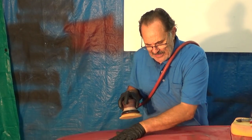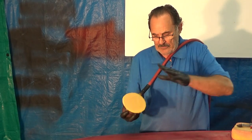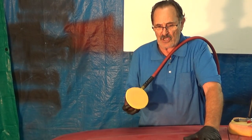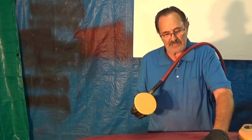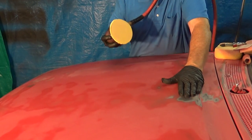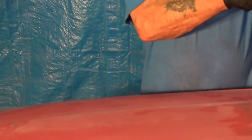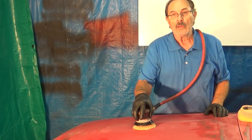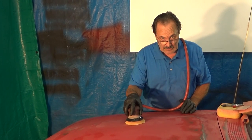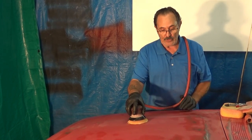I've got a couple of places right in here that need to be finalized. I'm going to use the DA sander — I'm already down from 80 grit, started at 180 grit on top of that, then cut it down more because you really have to eat on it to get through that paint and clear coat. I'm down to where I'm at the paint and in some places metal. You'll notice I've feathered it out in places that needed it because it might have been just a slight bit high. If it's low, you need to fill it in — I use the 3M Acryl product because it doesn't shrink so bad that it'll crack through your paint later. That's a good product to use.